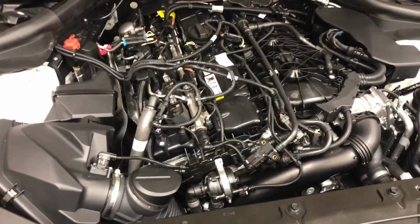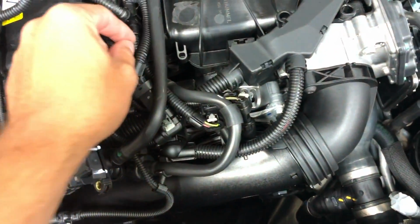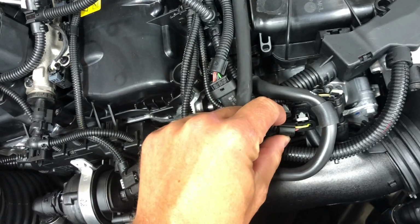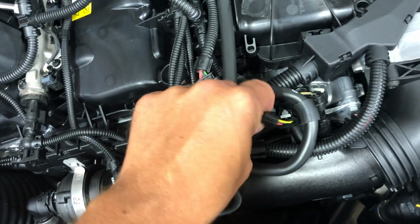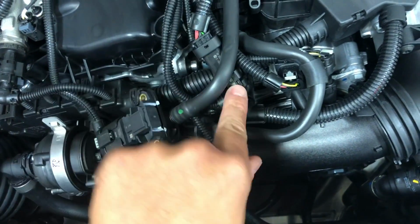On the install of the Titan Protune, it's literally as easy as A, B, C, 1, 2, 3. It's kind of funny, but there's an A, which is right here on the harness. So this A piece of harness comes down here, goes into the boost sensor. So you plug the one end in, you unplug the stock wiring, you plug this plug in on the new harness, and then you plug the other end right here into the existing harness. So you're basically jumping it.